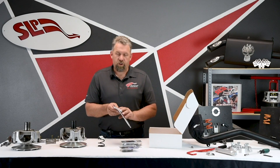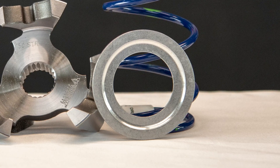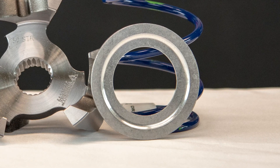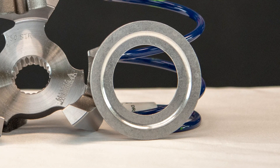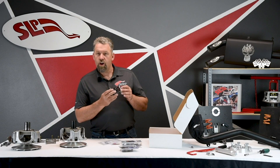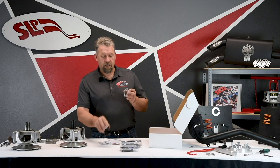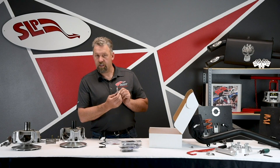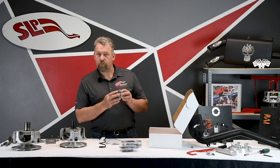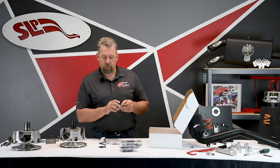It works in conjunction with the spring spacer, which is an aluminum part with a thin area in the center that steps out to a thicker area on the outside. That design gives the larger diameter spring extra room so it doesn't reach coil bind prematurely, while the thickness on the outside maintains the shift-limiting characteristic of the stock spacer so the drive clutch does not overdrive the driven clutch, causing belts to blow at top speed.